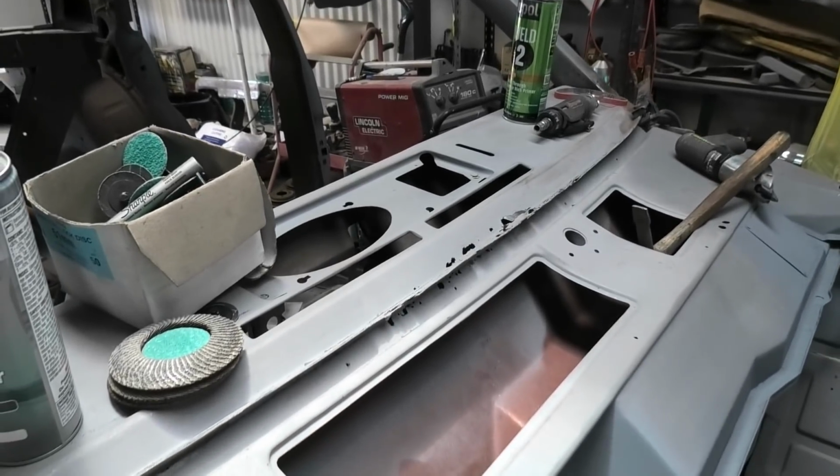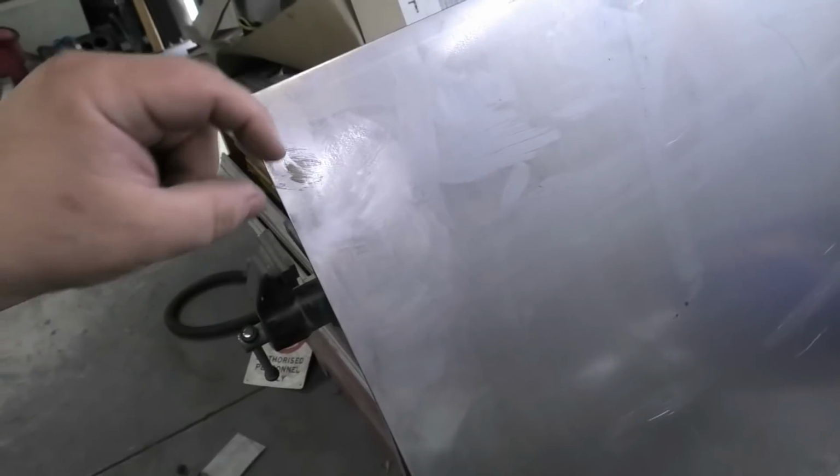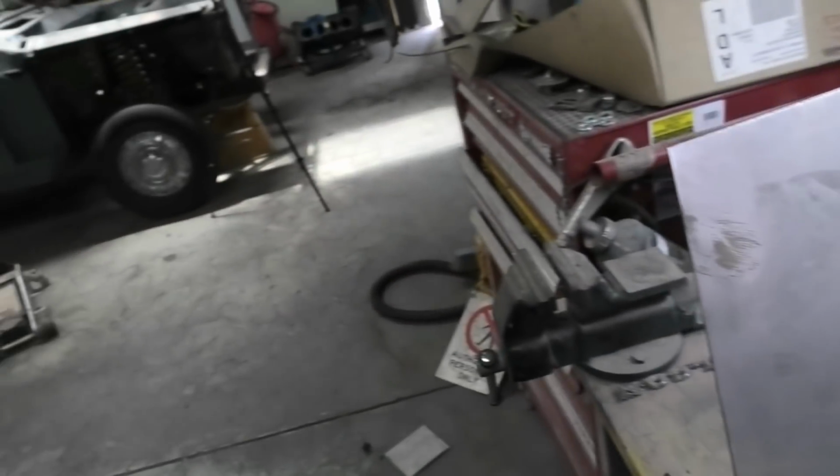So let's get cracking. I'll whittle up a new piece of tin. So I've got some fresh sheets, pretty cheap. I'll use my, what are they called? Calipers. Measure the gap on the car, scribe it on here, trim me off a piece that's a bit bigger, and then I can whittle it down. I'll fold the fold and then whittle it down a bit more, and then I'll start shrinking and stretching it so that the shape is about right. I think I might actually have to cut it going that way rather than that way.